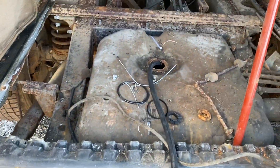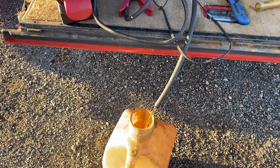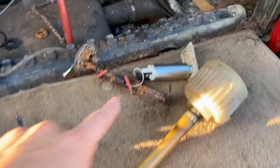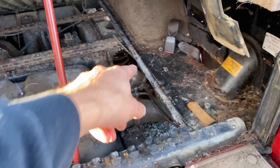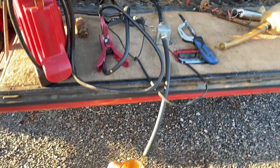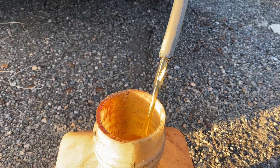We rigged up an electric pump just to pump out the old gas, which is probably a lot easier than running it to the front. We're going to pump that out, put the new remanufactured fuel pump in, change the fuel filter, and see if it'll start. That's probably six, seven-year-old gas coming out of there.